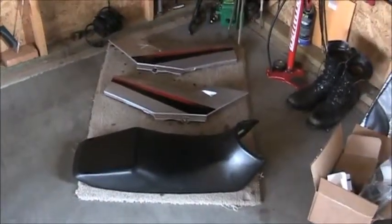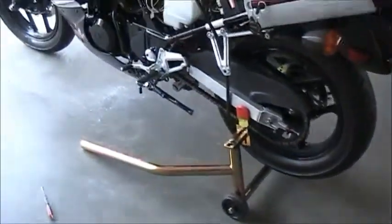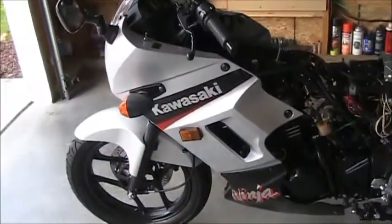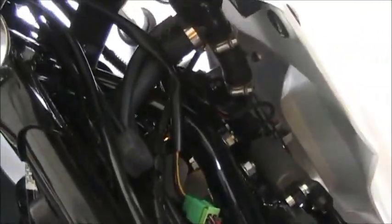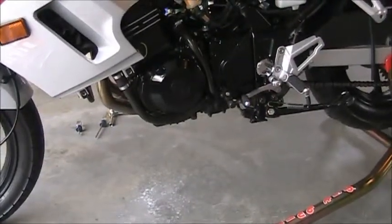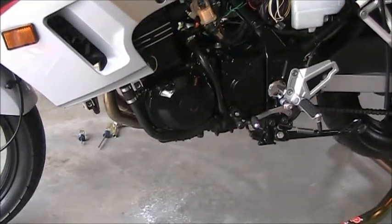At this point I've got the seat off, the side fairings off, and the fuel tank off. I'm going to try to stop there because I really don't want to take off the upper fairing. The lower fairing is easy enough, but the upper fairing is such a pain. I think I might be able to work around inside the fairing — there's the coolant return line up there, and there might be enough room to work with my hands. I've already slipped the thermobob in and out of the area above the cam cover and it looks doable. The bottom fairing is off and the sites you'll need to work on to install the thermobob are about as available as they really need to be.